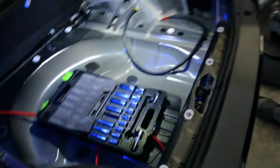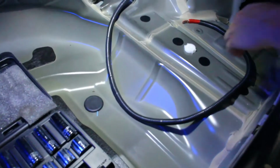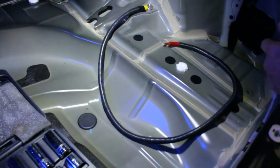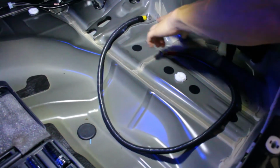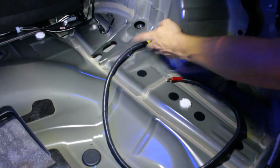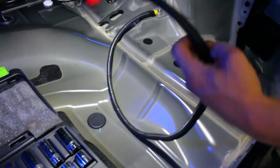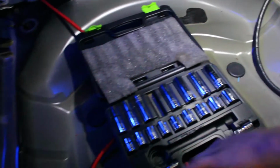Mr. Jeremy behind the camera right now didn't buy ground wire, so right now we're using the power wire as a ground, and we just threw a sleeve over it so he would know. So that's just already grounded out. We threw that connection over, and I just threw electrical tape so that would be snug and there won't be any wire showing. And this is just going to go straight to his amp.